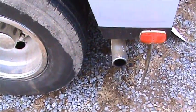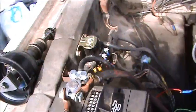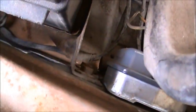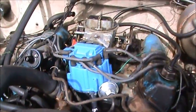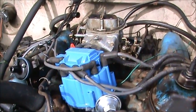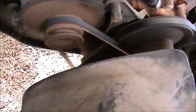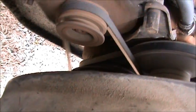It sounds a whole lot better. When it comes down to these DuraSpark ignitions — this truck here has some oddnesses with it. The plugs are cut off, got wires running that ain't supposed to be feeding that box. This over here has been messed with. The voltage regulator's molded down here — mine's over yonder, I've never seen one down here. It's just a bunch of weird crap with this one. I like this idea much better. I just hope my breather will fit back on. Anyway, I'm going to try to find the timing light. I've also got to find the timing mark on this one — there is a pointer down there.